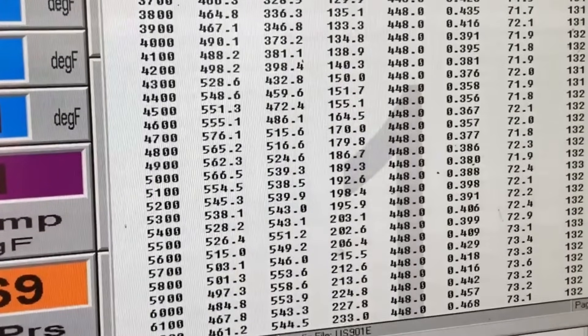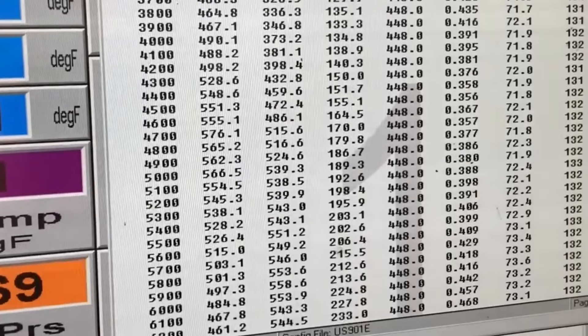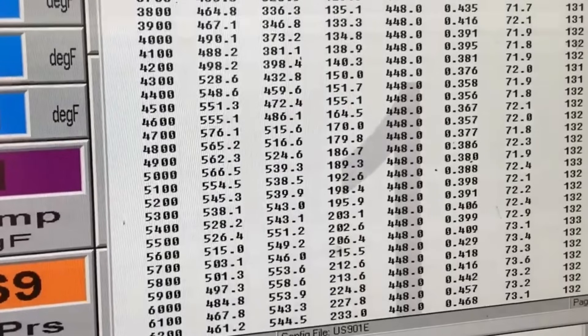The power's about the same, isn't it? Yeah, about the same as the spacer on the other one. But the distribution's better than the other one. See, that first cylinder was pretty lean — it was pretty lean all the way through the pull. And if you try to fatten that one up, you're going to fatten the others up too.